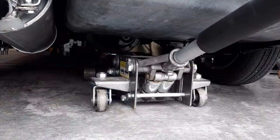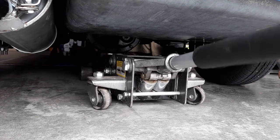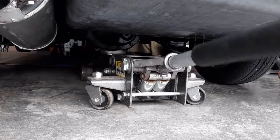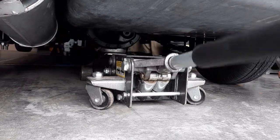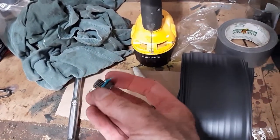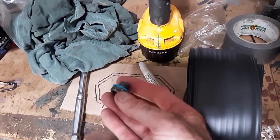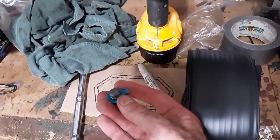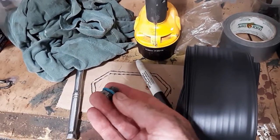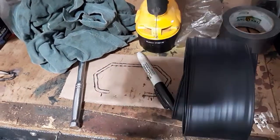At the back here I'm going to tip the car level and make sure I got all the oil out. Now, the drain plug had a little drip on it — I have a whole stash of drain plug washers for various cars. The only one that kind of fits is actually a plastic one, so I'm going to give this a shot. It's in the Dorman assortment kit you can get at the auto parts store.